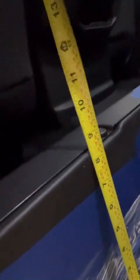That hump is huge. So what we're gonna do is plan accordingly to go about an inch and a half less than the height of where the chair hits, which is a little under 9 inches. So we're gonna cut that front panel at 7.5. That'll bring it an inch and a half less, and that'll be plenty of room for excursion. That way the chairs don't hit the surround of the speaker as it's traveling.